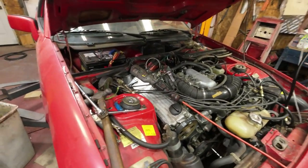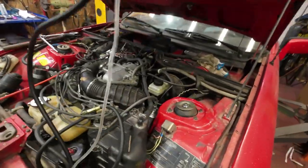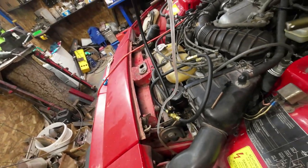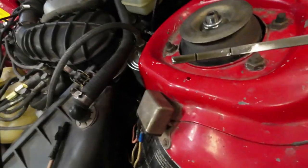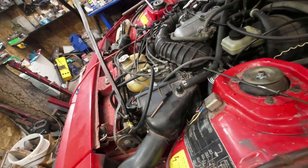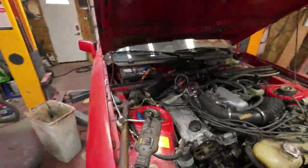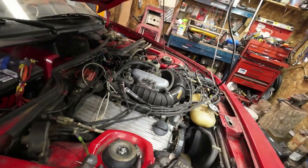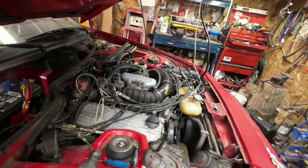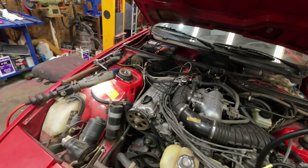Yeah, so I had all the cylinders full of gas. So now I'll check the oil, I think, and see how much gas is in the oil. Well, not too bad. I'll just do a little bit better checking here. Hang on. Yeah, I guess I better change the oil before I run it anymore. It was all full of gas one other time too. When I first changed it, it was pretty gassy. But it wouldn't hurt to change it again, so I'll do that before too long. I'll just carry on right now.